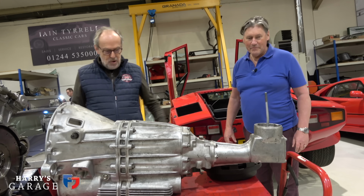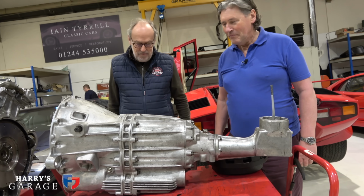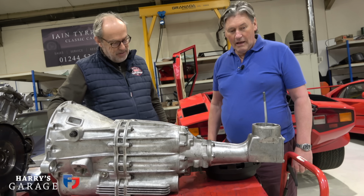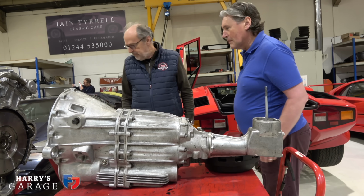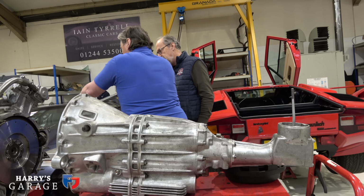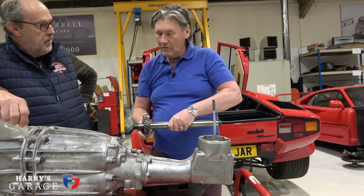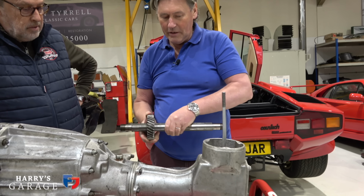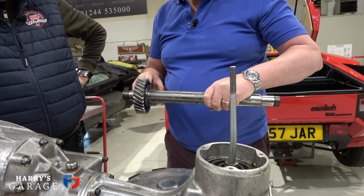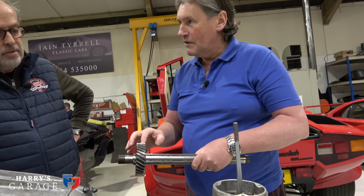So, a gearbox, look, it's back. What a world of pain the poor guy went through, because the gears arrived, didn't they? They weren't quite right in places. Here's Exhibit A. Just to recap, remember the noise, of course, only too well. That was what was causing it. If I move that along the spline to there, it's marginally better, but still too much play. But the problem was the gear that this meshes with, or rather the replacement, was a different tooth profile.